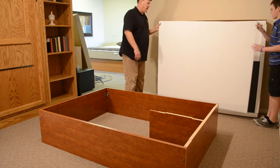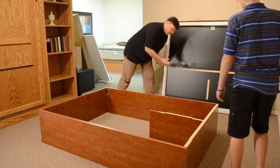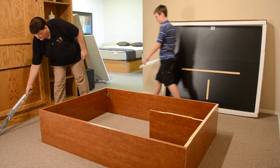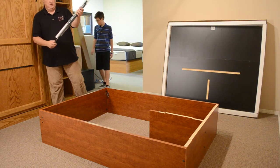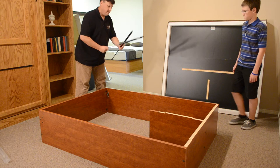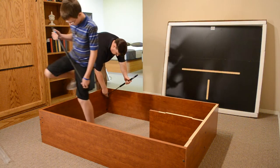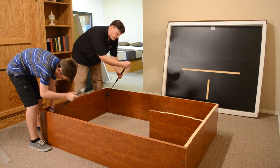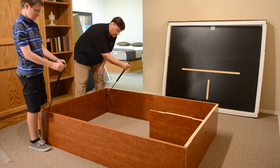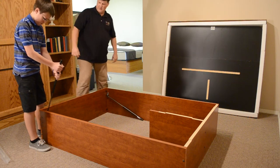We've taken the top off of the box with the top and are moving the packing material out of the way. Down at the bottom of the box you'll find your two pistons and your instructions. We can actually snap the shocks onto the bottom now — these go with the fat side of the piston facing up, so the skinny side pops onto the bracket at the bottom. The little end on the opposite side should have the little ball facing outward; if it's not, just twist the whole shock until it's facing out, and lay them on the ground.